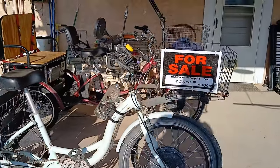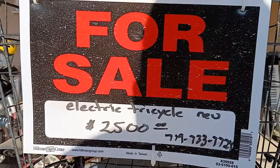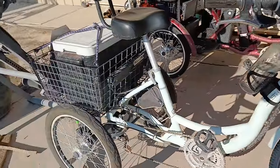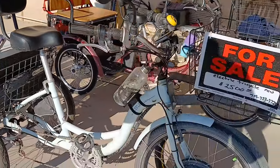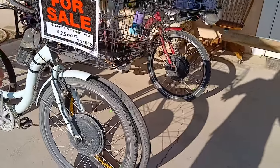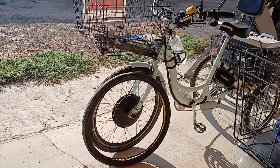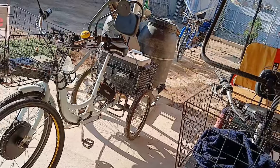Anyway, Enlightenment is my business name, and Solo is the trademark of the trikes I'm building. They're Schwinn Meridian frames, which are an ideal great frame, with a Dream Bike tricycle conversion rear axle, which is just an awesome combination. 1,000-watt motor. Hopefully I'll be able to get more of these, but these are awesome. I can't stress enough how much better they perform than they're rated. I pump 1,200 to 1,500 watts on a burst, and it's never kicked out or anything.